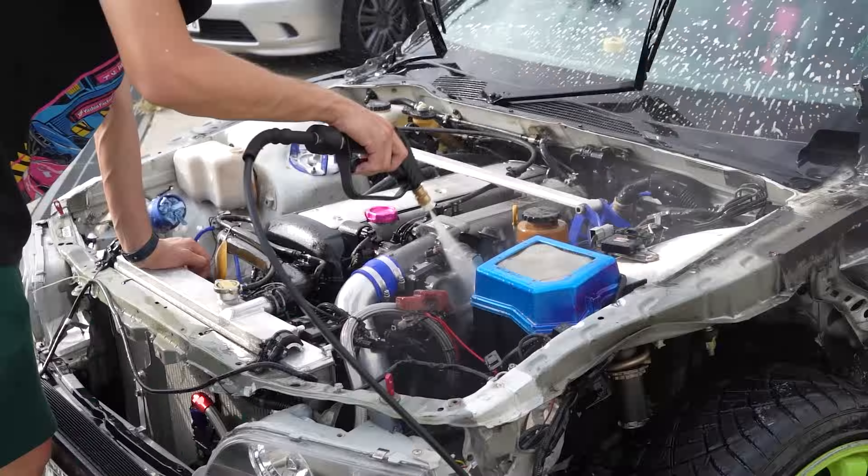Obviously it takes many many years to get good at this kind of stuff, but I was just giving it a real hot go. Because we were welding them on and pulling, it started making a few holes in certain places from where the weld broke away from the body, so I went and welded all those holes up. That turned into me chasing it for a while - even though I had the welder set at only 50 amps, super low, using 0.6 mil wire, it was still super thin. I'm really surprised how thin Toyota panel steel is. I also stitch welded up the seam here and I will be putting seam seal on everything - my whole goal was to just pull it out more, which I have. I'll flap-disc all of this to make it smooth. It's not perfect but the door closes really nicely now.